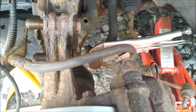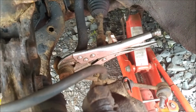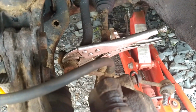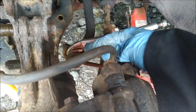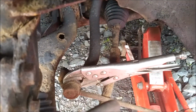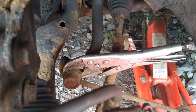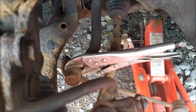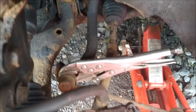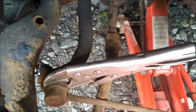This is a relatively recent drop link with fasteners covered in copper slip. This particular part, the bottom part, has failed. There's play in it, and the nut doesn't want to come off, so there you have it. If you think things just come loose up here in Scotland when you use anti-seize compound, you might be disappointed.